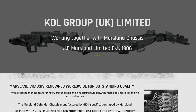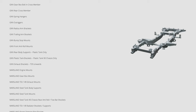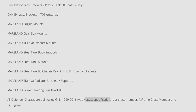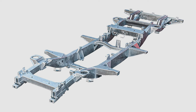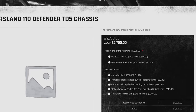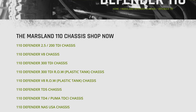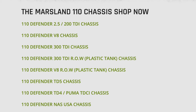Marsland chassis: Marsland doesn't make chassis — they buy blank chassis from GKN. They then weld on engine mountings, gearbox mountings, and other brackets, but they only come with PUMA TDCI rear crossmember and A-frame upper link mountings — that's what they mean by 'latest specification.' The main rail thickness is 2mm, using two C-channels welded in the middle, same as the genuine one. The retail price for a 110 TD5 galvanized chassis is £2,750 ex-VAT. Marsland stopped supplying direct and began going through dealers in 2017. Model lineup is 2.5, 200TDI, 300TDI, V8, TD5, PUMA, and North American specs — all 90, 110 and 130.